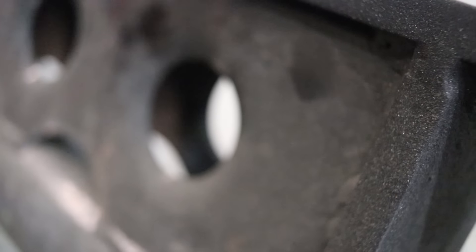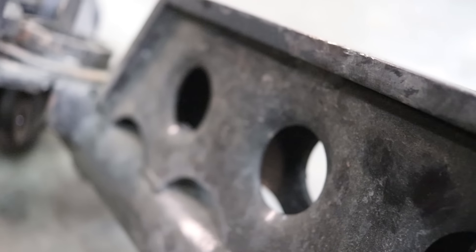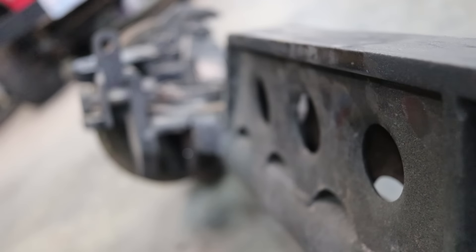There are some good options out there, which is really nice. Even though I have half-inch-thick axle tubes on my axle, I put a truss on it. If you're serious about wheeling anything, put a truss on it — people bend Dana 60s, people bend 14-bolts, people bend big stuff all the time. Weld a truss on it while you've got it out of there. If you're like me you can build a truss from scratch for 20 or 30 bucks in material, or you can buy an Artec kit — a few hundred bucks and you've got a bulletproof setup. It's really cheap reassurance in the long run.